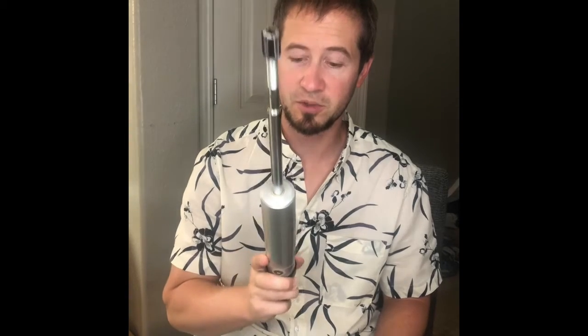The KYBs, which I'll show you, fit not just the full-size Ford and Mercury, but also mid-size GM cars from the 80s, like G-body cars, which I think that shock was really made for. So it really does not handle the dampening of the huge full-size car, all the weight that's on there and that massive spring. It needs a lot of dampening. And this also fits the G-body, but it's adjustable, so we can tune it up to just the amount of dampening that we need.